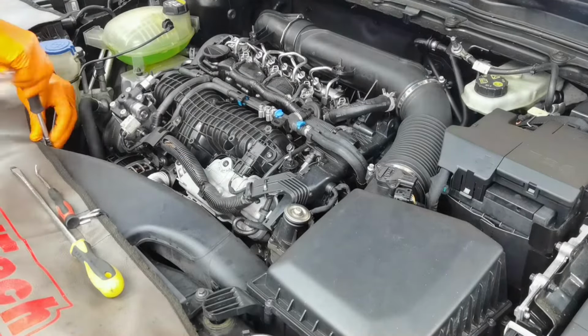So right here, I still don't have enough space to lift it up from the engine, so the next step which I have to do is to remove the metal pipe which is coming out from the high fuel pressure pump to the injector number 2. You'll have to remove the two ends using a 17mm key, and you'll have to remove the little screw which is securing it mounted in place with a Torx 30.